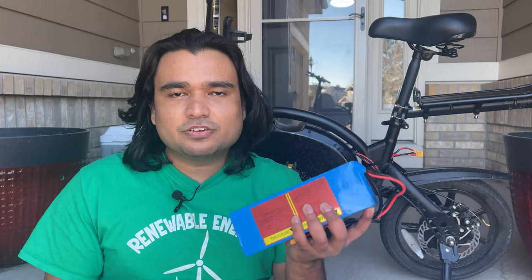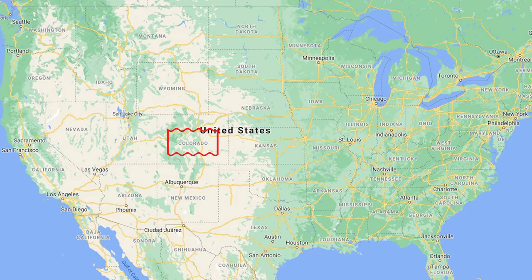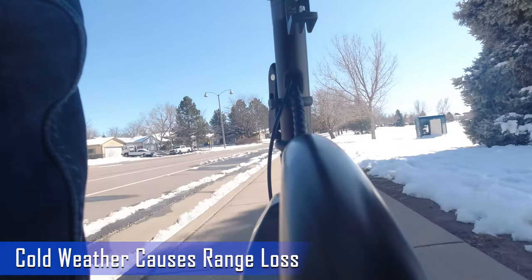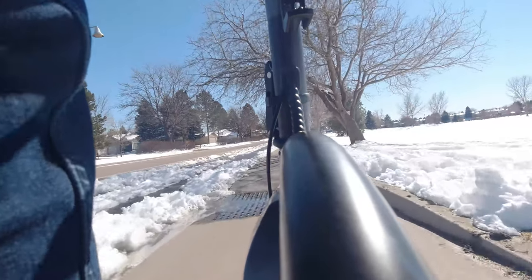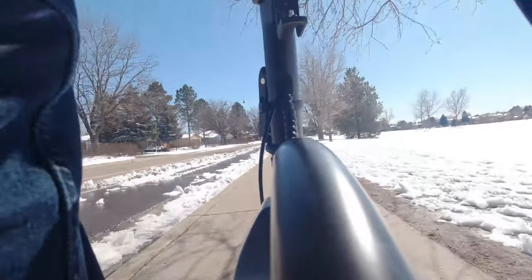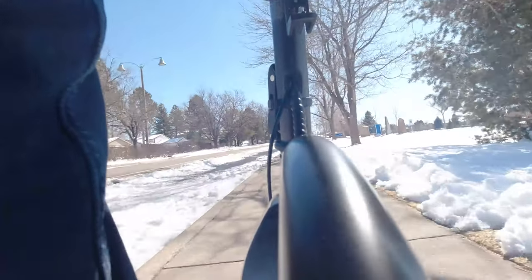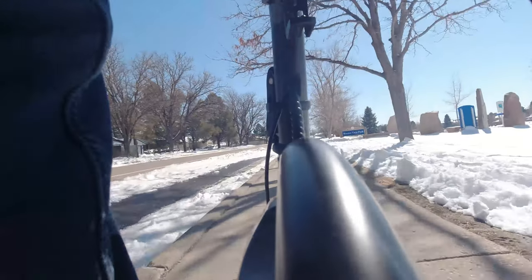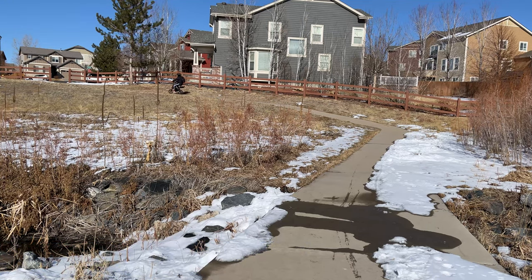Before I show you the numbers from my range test, I wanted to make something clear. This is a lithium ion battery and you need to understand a few things about how they work and how they affect your range. Since I live in Colorado, it gets pretty cold in the winter and our trails are not flat — we are in the Rocky Mountain region. Cold weather causes range loss; these batteries rely on chemical reactions to work, and cold can slow and even stop those reactions. You will need to charge them more often in cold conditions. My tests were conducted below 50 degrees, so range will probably be a lot lower than what you'd get in a warmer area.